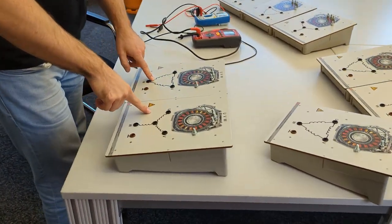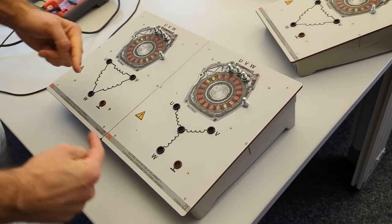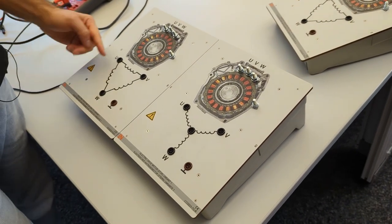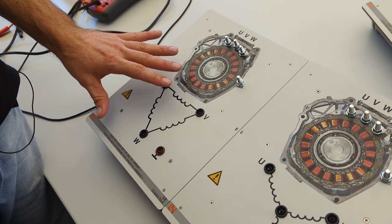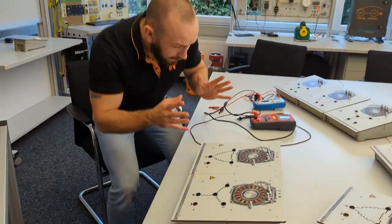Looking down here, we see there's a different way of connecting the coils from the stator with each other. On the right-hand side we have the star connection, where the different coils are connected as a star with the star point in the middle. On the left-hand side we have the delta connection, where there is no star point because all the coils are connected with each other. The big thing about this is you can't see from the outside whether you have a delta or star connection — it just depends on the car manufacturer. When thinking about the difference between delta and star, you can't say only one type is used in cars; it depends on the overall strategy of the car manufacturer.